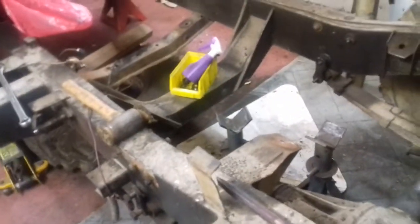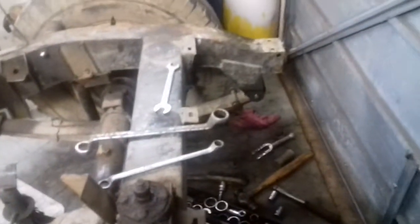The one on this side is on the move, and the draglink - as you can see the rod ends - it doesn't want to go anywhere. The brake pipes have been disconnected, the shock on the other side has been disconnected, and I've taken some of the brake pipes off - I'm going to renew them all. The front bump stop has been taken off and is hanging against the wall over there.